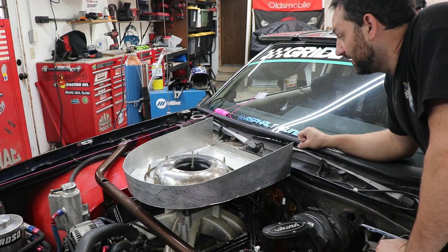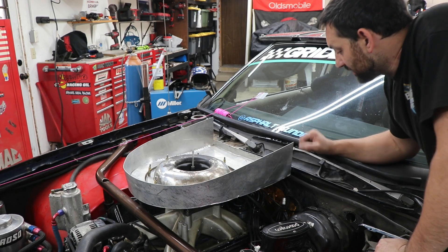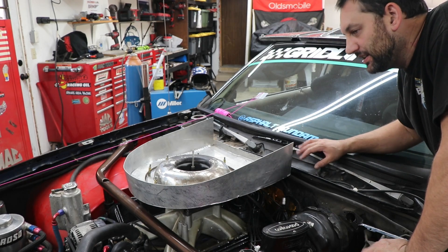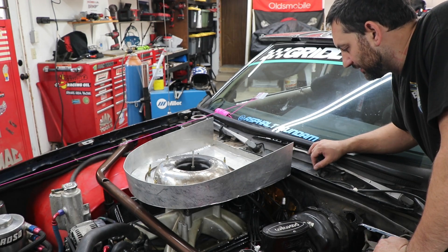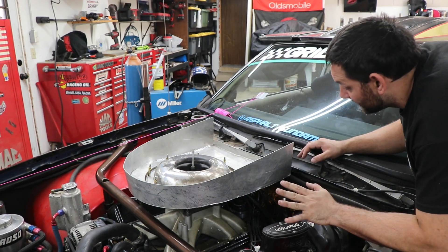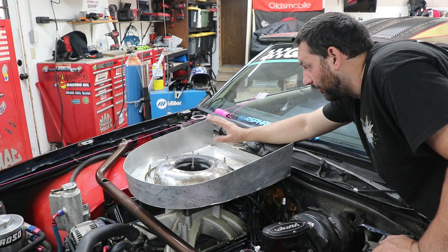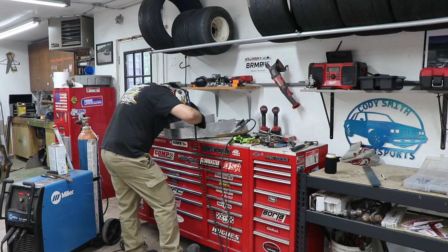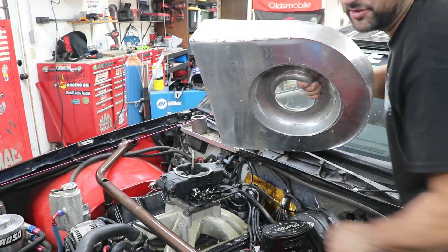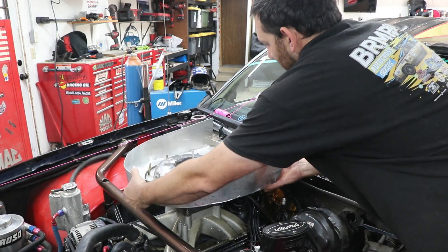This is not going smoothly at all, especially trying to weld and tack thin plate to thin plate on the outside. I keep finding contamination — it bubbles up and doesn't want to stick. But if I can get a couple of tacks on, I can switch over and run a decent bead along the inside, then flip it over and fusion-weld the outside by just melting it together. What a pain this is right now.